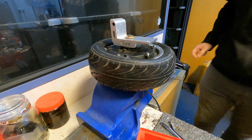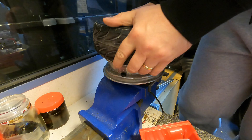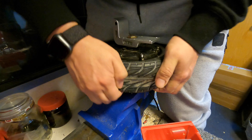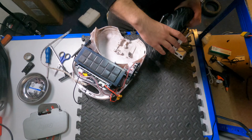I was going in circles — as I pushed part of the tire into the rim, another part would start to stick out. So I called in special reinforcement and got some help from Ian. The trick is that you need to get the tire in at an angle, and then you need to pinch the tire to get a bit more leeway when putting the tire onto the motor. It was a long and hard battle, but finally we were able to get the tire onto the rim.